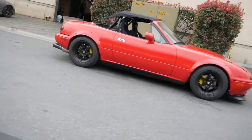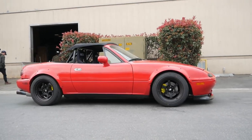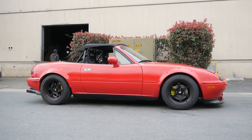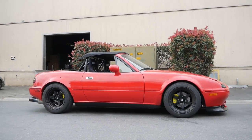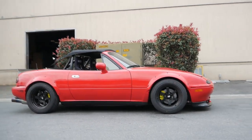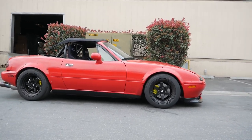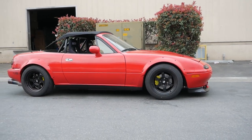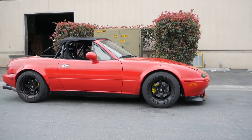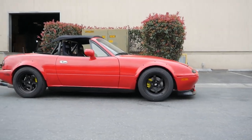This is just the quick and dirty way of painting your calipers. If you want to do a little bit of a better job, cleaning is going to be top key. As we saw in the paint episode when we painted the whole car, cleaning and prep is more important than the actual technique of painting. Overall, I'm pretty happy with it. One can each of color, clear, and primer got us these results — probably only used about a quarter of the can, maybe half tops. So we can definitely do this again another time, but right now it's a nice little accent.